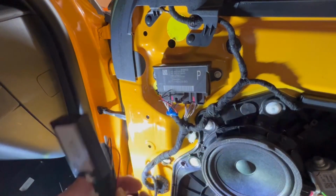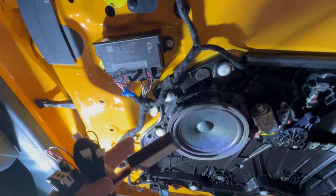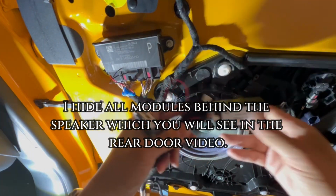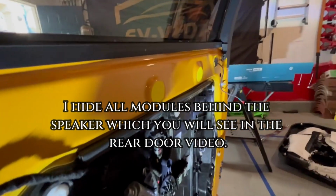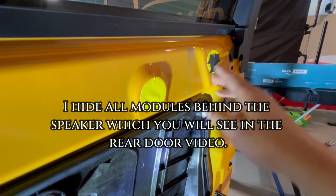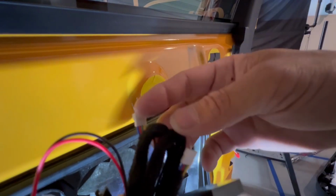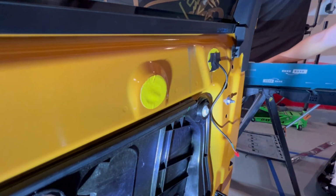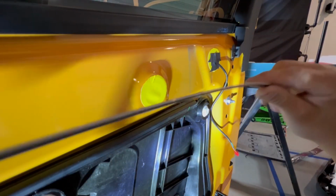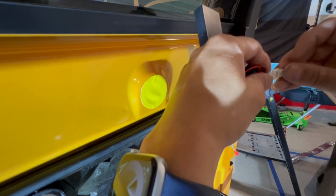So, a couple of things you can do. I actually open this all up, and that's something that I would recommend, but how you want to mount it is up to you. I open this speaker out and put all my stuff to the back side and tape it down so there's no rattling. And then I routed the wires, as you can see, up and through this little tape area. So I basically removed the tape and punctured the hole and then just extended the wire out. So it's one of these wires out here, right? One of these wires. They all can work. They're all universal. And what you do is that once you have it out, this is the connector for our light strip. You basically have it at the edge of the door, and then you can connect like this.